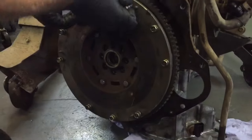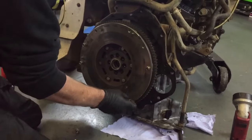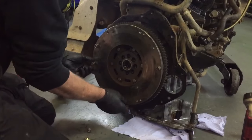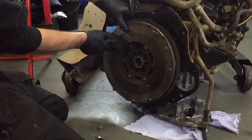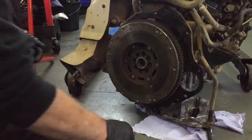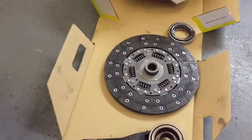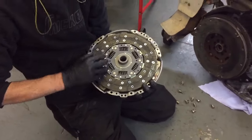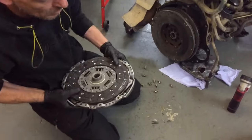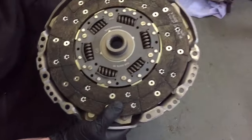All of these are the pressure plate bolts — there are nine in total. Now the clutch will only fit one way, so you might need a few attempts. There are quite a few people that have been caught out with this. The LUK clutch is the best clutch you can use — heavy duty, most long-lasting. The pressure plate's extra protruding bit fits in there like so. You don't need a clutch aligning tool because the pressure plate fits perfectly with the friction plate. Just make sure that it's equal all the way around.